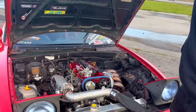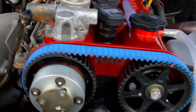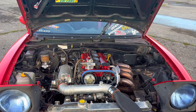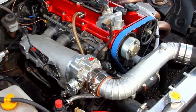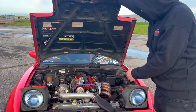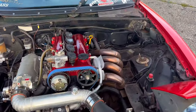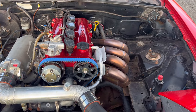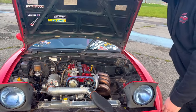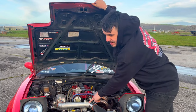If you've watched our previous videos you're probably sick of this by now, but it's a freshly redone 1.8 VVT engine out of a Mark II with quite a lot of fancy work done by our friend Brin. It's a VVT engine with a 2mm head skim, Cat Cams, Skunk2 big inlet manifold and throttle body. It's got a Weldman Motorsports tubular manifold - these are quite hard to find for MX5s, they're based in Poland and will make you any shape you want and they've got dyno graphs to prove the differences.